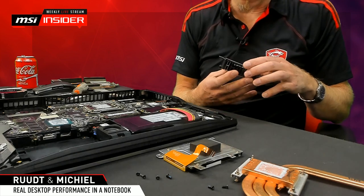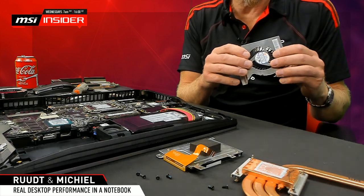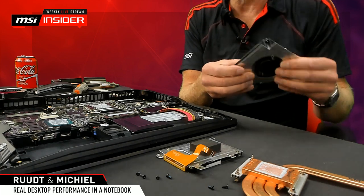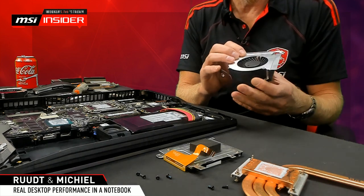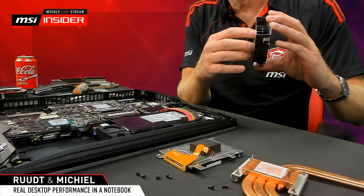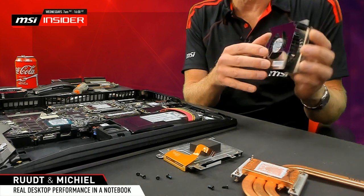We also had a question about the fans I saw earlier. Can you swap out the fan inside, and did you still use the metal cover? I'm not sure if you can take it apart. Well, it's part of the metal as well. So the fan is really integrated in the metal. Yeah, in this model it is. Sometimes you see three screw holes, so you can really take out the moving part. So it's not that you can get a standard size part and just swap that out. This seems to be glued, I think. So this one is like one package. You have to buy the whole thing. Yeah, you can unscrew these parts, but if I look at the metal part here, the PCB part is just glued to the metal part, so it's one package.